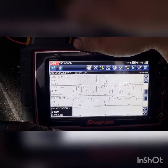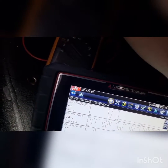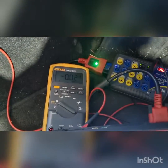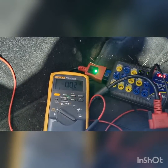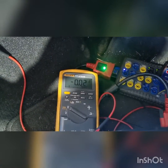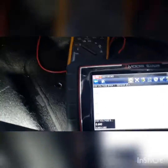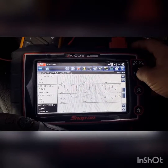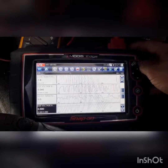It was needed to confirm that we actually had a half-volt bias rather than just a bad ground. If I connect onto the ground lead — you can see our actual sensor ground to the sensor ground circuit is actually perfect. So that proves that it is a bias voltage. It needs a new sensor; it's working okay at the moment, but that's just typical of these kinds of faults.